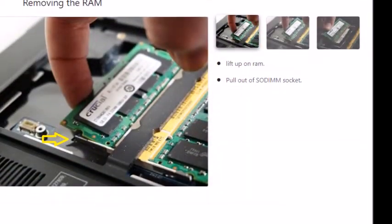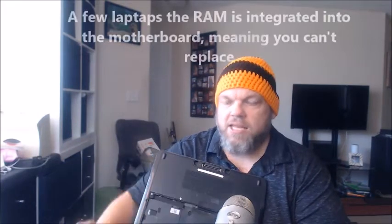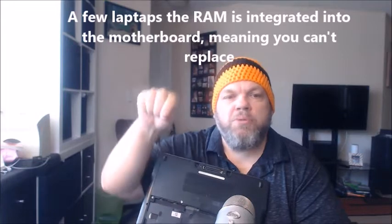Next thing I want you to do is check the memory — the slang term is RAM. This particular one is called a DDR3, but the majority of newer laptops today use DDR4. Take your battery out again. On this Dell the RAM is underneath the bottom panel — you'd unscrew that part and it'll be under there. On YouTube there are tutorials on where to find the RAM. Usually laptops have two of these side by side, and they basically just click out.